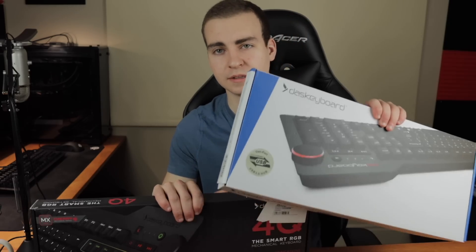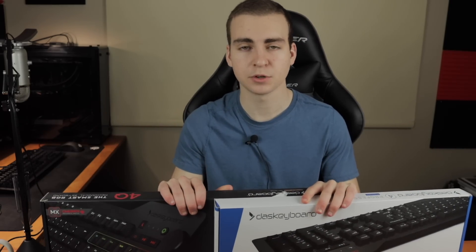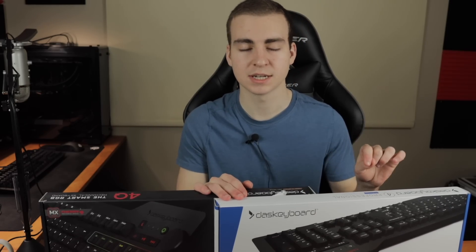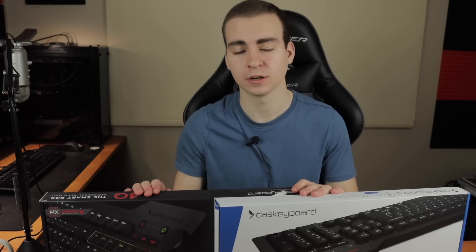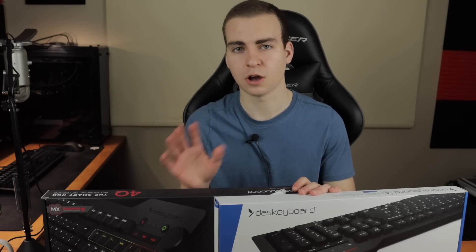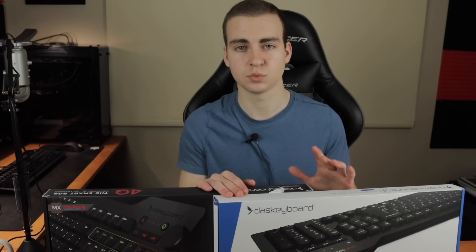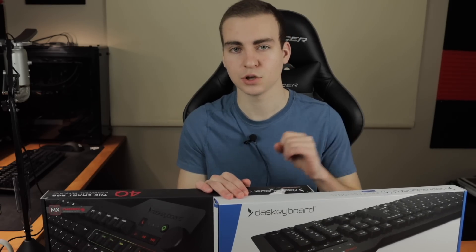So that's the two big differences between these keyboards. In summary: the blue is a little bit heavier to press down, a little bit louder, and has that clicky sound to it. Whereas the browns are a little bit lighter, not nearly as loud, and have more of a thump or kind of a thud to the press. These are both great options — I'm confident you're not going to be disappointed if you get either of these keyboards or any keyboard that has these switches inside. I hope this gave you the knowledge you need to go out and pick your next keyboard.